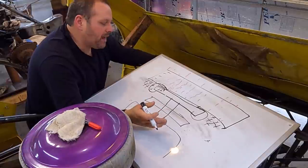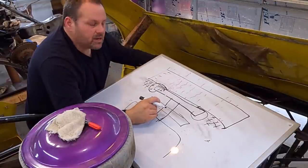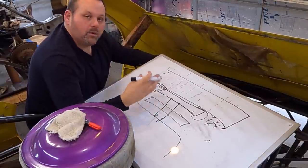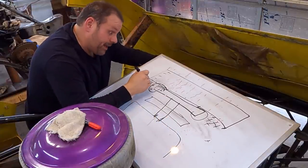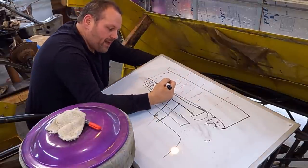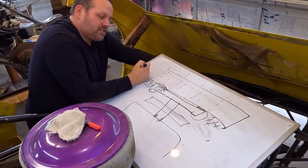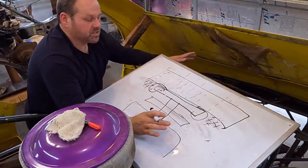Years ago, I didn't understand. They're like, you know, man, this thing's been overheating and we moved it all the way up against the radiator and it's even worse than it was. I was scratching my head. Then we worked out the math on it, started looking at it from an engineering standpoint, and it was making it worse. And this is why: the air was being pulled through right in the middle, and then it was making this big wave of high pressure off the edge of the fan. It was just stopping all other air from coming through. So it was even worse.